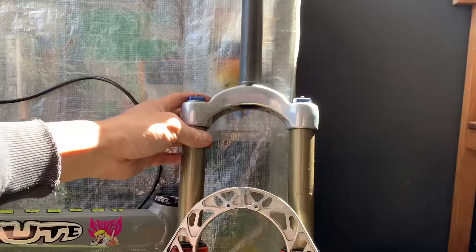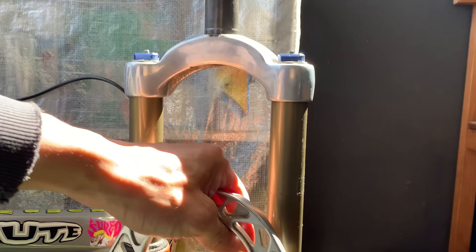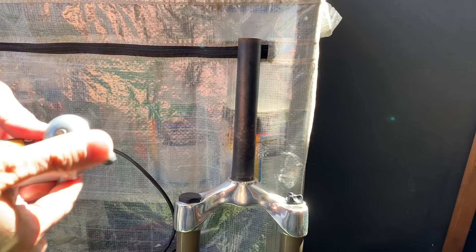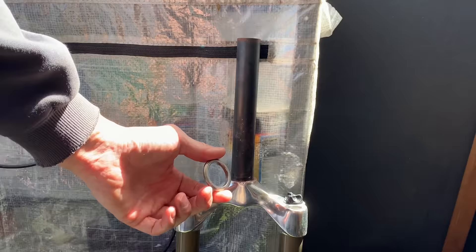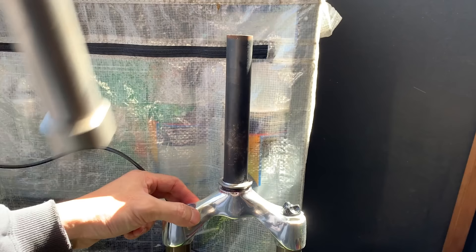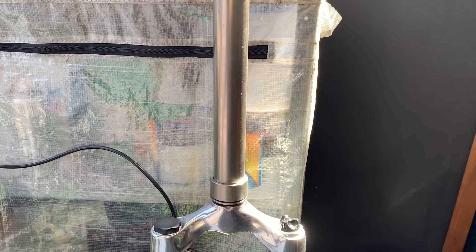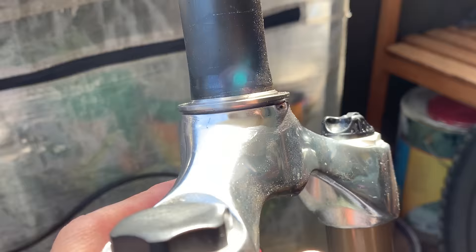Just like that. Giving it a quick clean, and now I can put the crown race onto the other forks. Just gave that a wipe down as well. Here are the other forks — I just put a little bit of grease around the crown so it's easy to take off again if I want to switch forks. A tip I learned from one of you guys: I used to hammer from the bottom, but someone said hammer it from the top so you don't damage the race. Tried that this time and it worked out well.